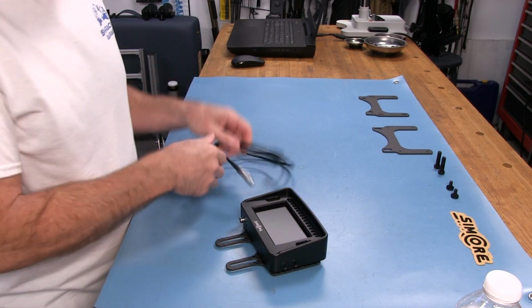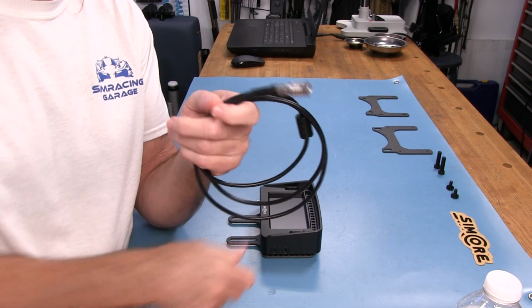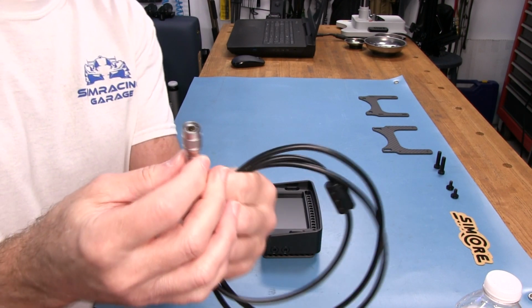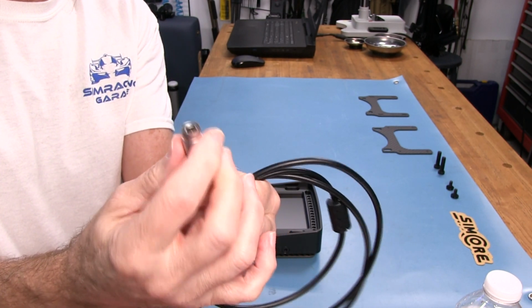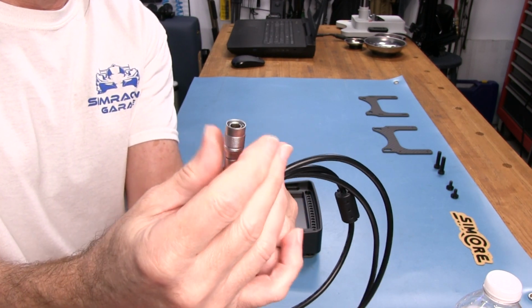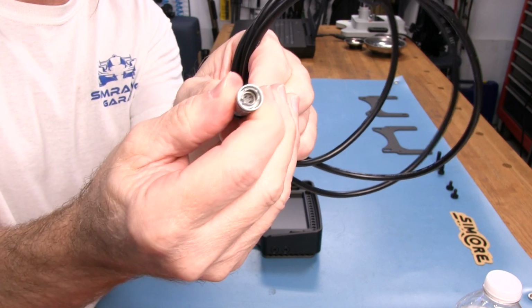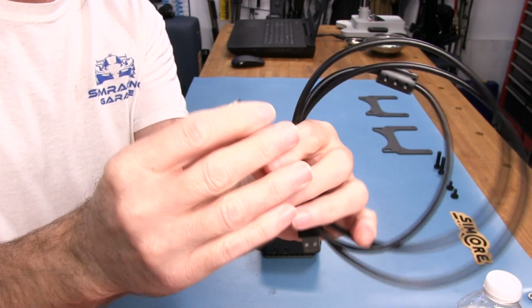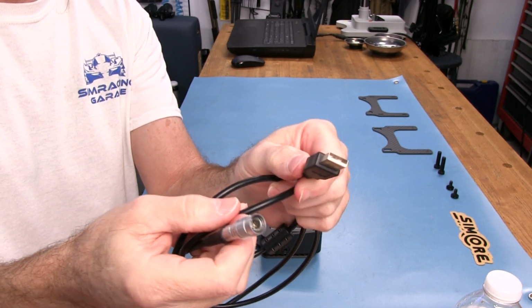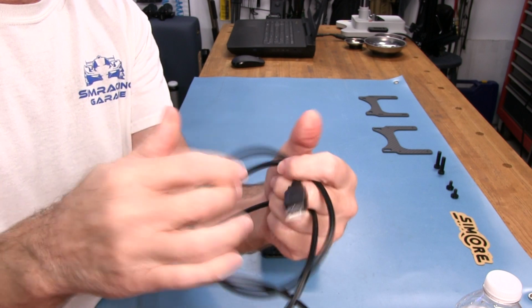Right. The cable that comes with it, very nicely done. Again, details are everything, guys, especially when you get into the finer pieces of equipment available in sim racing hardware, and the manufacturer needs to do things like this to justify the price they charge for these things. And I think this does. This is actually a spring-loaded collar on here. It reminds me of some expensive headphone cables that I've bought over the years. It's a little spring-loaded piece that snaps back up, and you can see it has a multi-ridged or keyed piece on the inside here. Of course, it has 4 conductors for USB. Just when you hold it in hand, it's very nicely done. Good shrink wrap there. Everything's just done quite well. Of course, it's the normal USB-A piece here, and we even have a nice ferrite core manufactured onto the cable, not just one of the snap-on units. I always like to see a ferrite core.